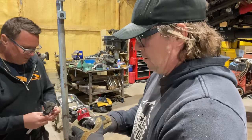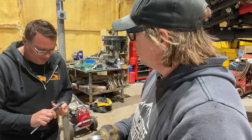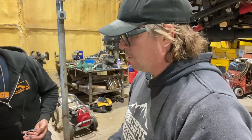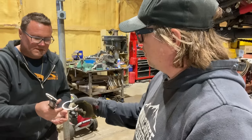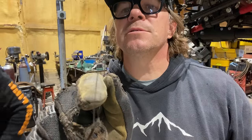I went through our bearing kit here, and we're going to measure each one of these and see if we have a 5/1000ths. If not, this is a 3. We're going to put a couple together until we make 5/1000ths. So three, we would need a two. Here's a five, so I made that easy. Look at that. It's so thin, it just disappears when you turn it sideways.